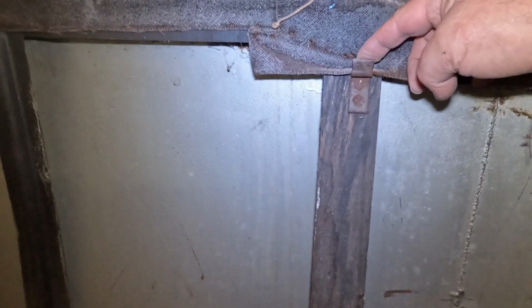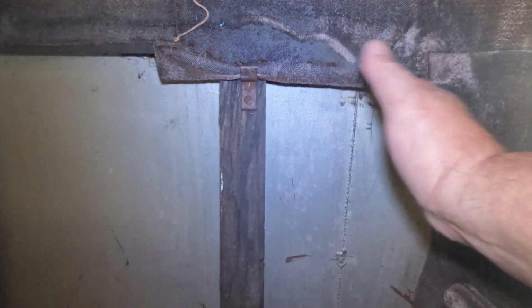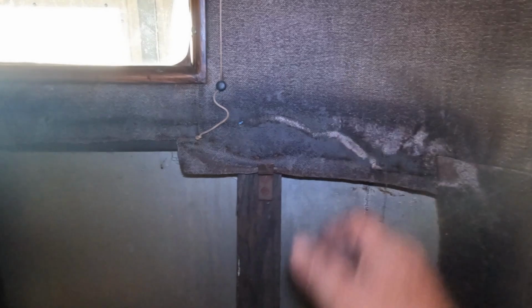All right, so we've got the rear seat out now, and the top of the seat, just so you know, it's held in place with these clips right here. And if you grab the seat from back here and just kind of push it in a little bit, it'll lift right up and out it comes. The armrests, we're going to take those out next. Now, there's a slide-in lever here. You can see that screw over there. That's kind of hidden by the seat. And so we're going to go ahead and take that out next.